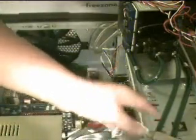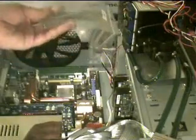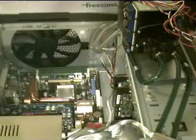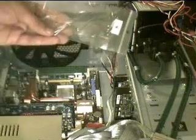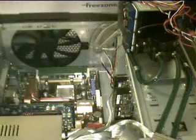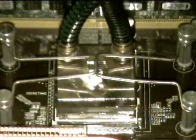What I'm going to do now is install this piece. I simply just place it on the CPU, and with the brackets provided — or depending on your motherboard you might use these brackets, but for this one it's just these brackets — I'll secure the CPU piece with these. After I do that, I'll start recording again. As you can see now, the part that covers the CPU is in securely.